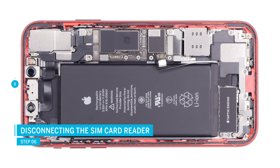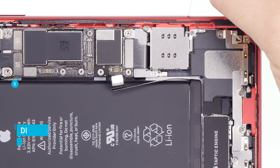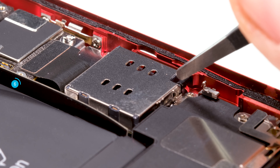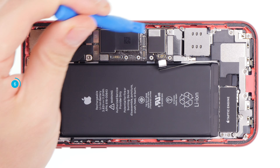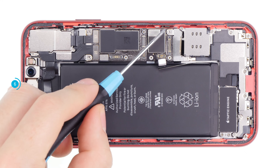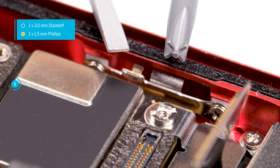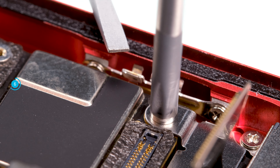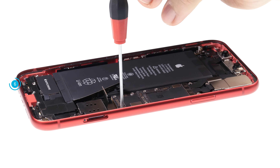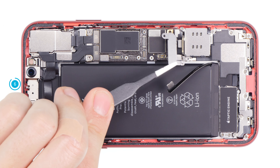With the iPhone 11, the SIM card reader is again a single component — as it was with the iPhone XR — and can be replaced individually. First, remove the SIM card holder from the device, then push the small pin back into the housing. Next, disconnect the large contact of the lightning connector assembly; the SIM card reader connector is located below it. Loosen the two screws of the cover — for the standoff screws there are special screwdrivers with a centering pin in the middle, though a narrow slotted screwdriver also works. Then remove the cover and separate the connector carefully with a spudger.